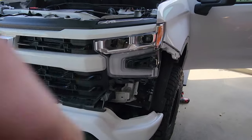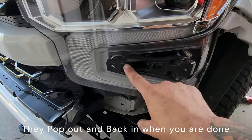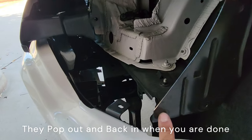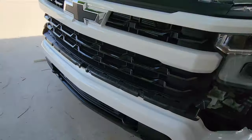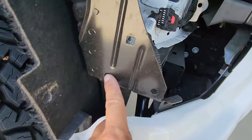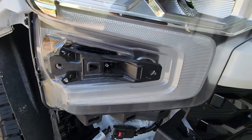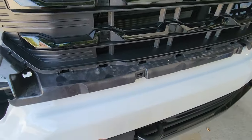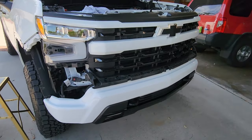When you pull that off, you have these little tabs right here — pull them out. You've also got tabs that go in right here as well. Pull those out; if you break them you can buy replacements — I'll post that in the description. Mine didn't break. You've got two tabs right here and two tabs up here — pop them out, they come right out. Everything basically comes out right here. Pull off that front valance part.